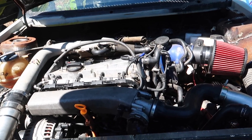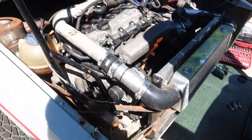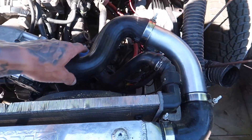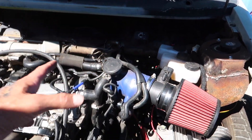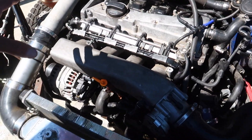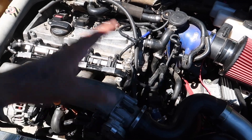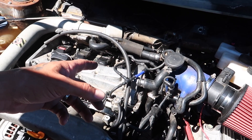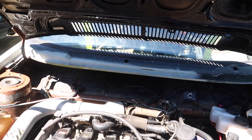It's gotten so hot outside - I had to park my car with the hatch back open to give myself some shade. I think I have everything done in the engine bay now: boost sensor grounded to the ECU. I'm not gonna put the ECU in until I hook everything up and make sure nothing sparks. Everything is wired just like the MK2 VR6 MK2 180, except the battery cables are going to the back. Should be good to go - heading inside to splice power to the CE2 box and hopefully get this thing fired up.